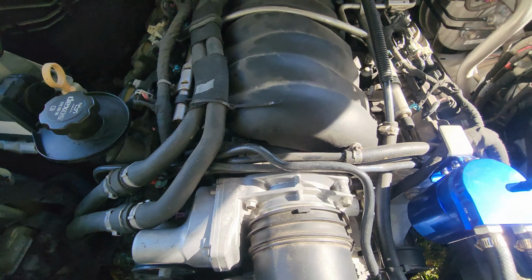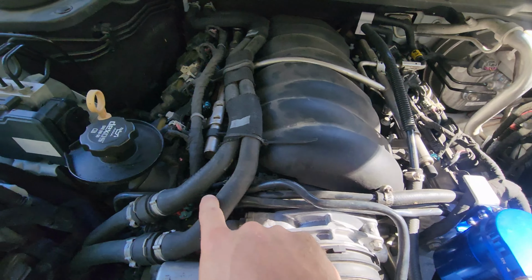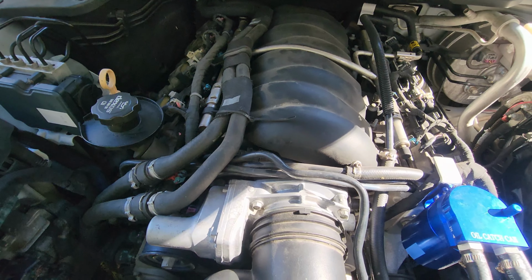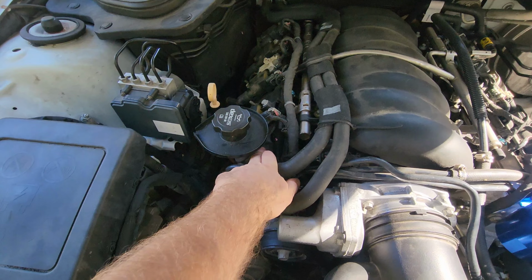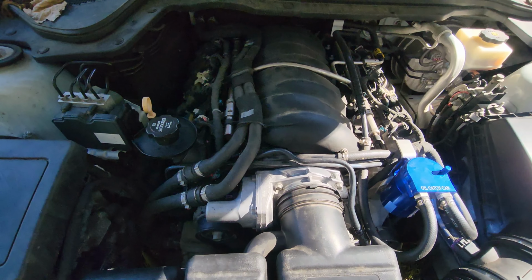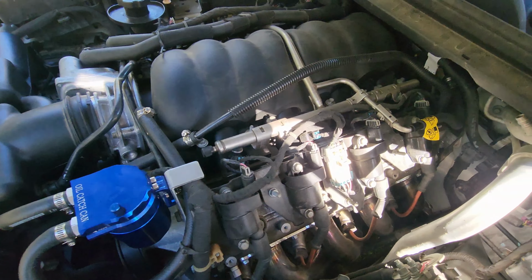The dirty side is the back side of the motor where all the vapors make their way up to the back, and then the clean side is where it's going into the intake. But I see very frequently going from intake to intake, or from the front of the valve cover on some of the GM trucks that have it up here going into the intake. But that won't extract any of the things you're trying to extract from the oil vapors into the catch can.